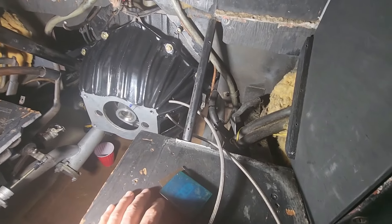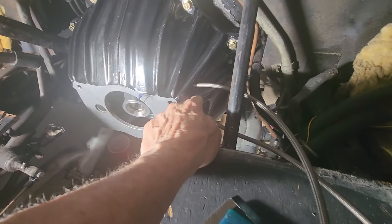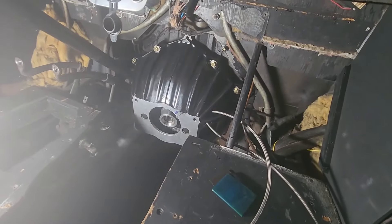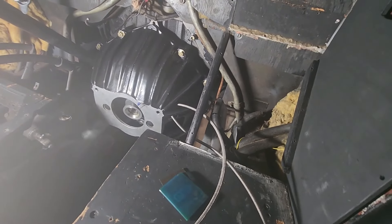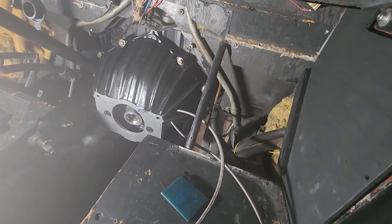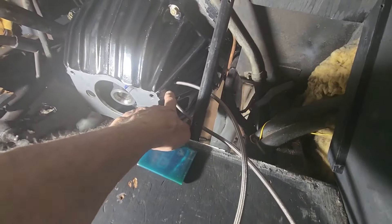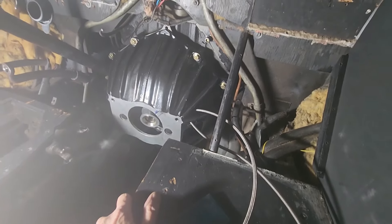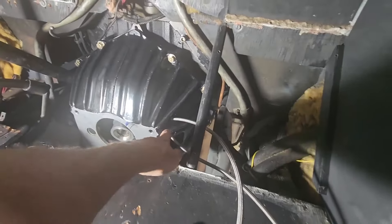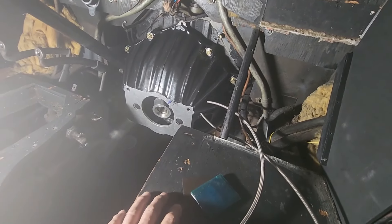I do have custom grommets that I've made that fit these two things. What I might also do is, as a kind of backup after I put them through the grommets, put some sort of clamp to make sure the hose cannot possibly move in and put more slack inside the bell housing. Unfortunately, when I drill the holes in the bell housing, it's tempered and you get little tiny chips — typical of cutting hardened aluminum — so I don't think I could get the drill at an angle anyway. And I don't want the pieces falling inside the bell housing because I can't get at the bottom — it's a full 360. So unfortunately it means I'm going to pull the bell housing, drill a hole here, check the fit again, and continue on trying to get the transmission back into the unit.